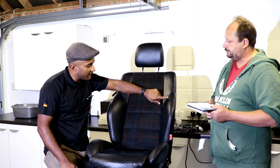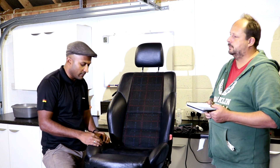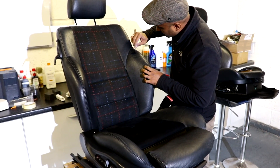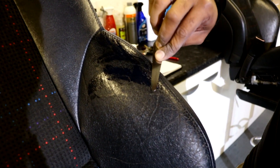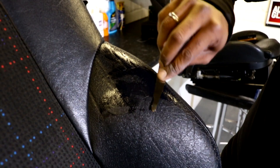Step five is an optional step. Certain bolsters can have deep cracks along the side of the base — areas where you get in and out and general wear over the years creates deep white cracks. If you want to fill them, you can use the Fluid Leather Filler, which is a very flexible DIY filler product. It comes in black, white, and custom-made colors to match your car interior, which is important as tinted filler means far fewer layers of paint needed to cover it.